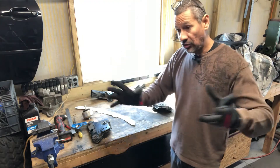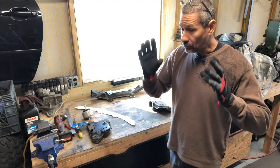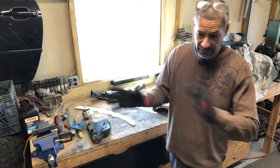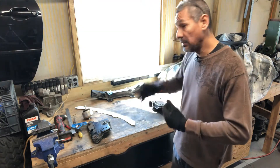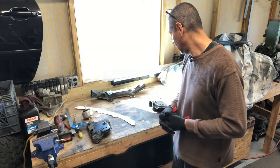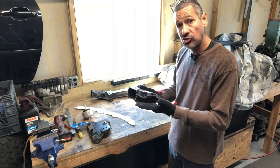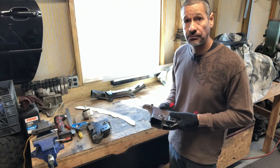It's a little tough because as I'm down there looking at everything — when you do one item it's going to affect the next. If you think something is going to clear, it might not work out that way. I'm just taking it one step at a time, keeping mindful of all the other items. I'm going to cut one of these pieces off, put a quick template on it, tack weld it, bolt it up on the car, and see where it lies.